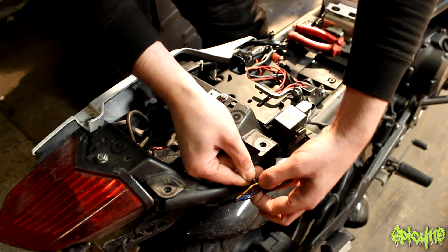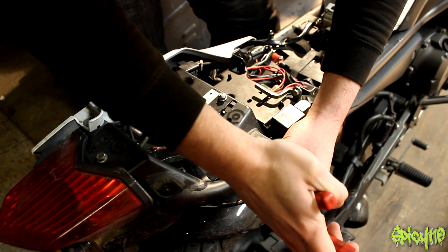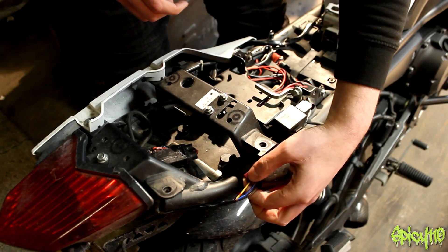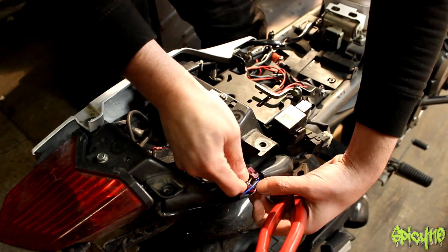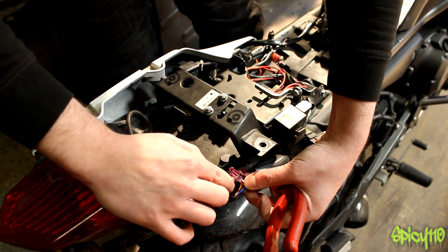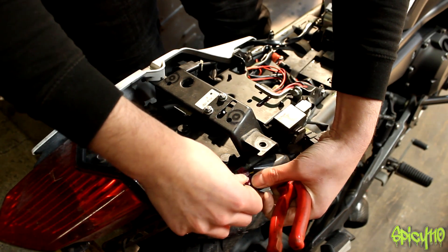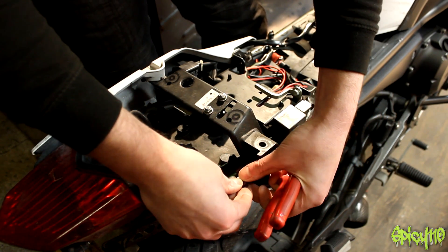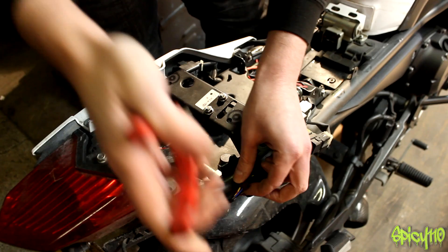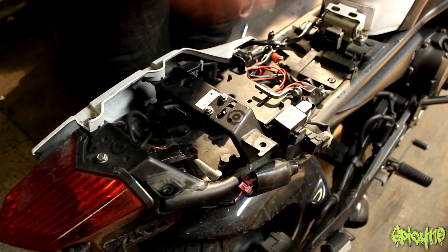I'm trying to stagger these. Clamp it and that should have gone through. These aren't the best way of connecting things — if you want to do it properly I would chop the wire in half, put both ends into a spade connector, solder it in, and then heat-shrink it for a much better sealed unit. But I'm going to test these as the manufacturer intended. Worst case I can go back, cut all the wires, and remake leads to match up.